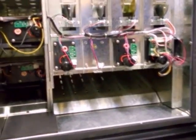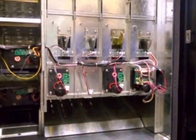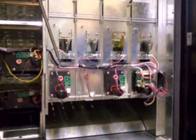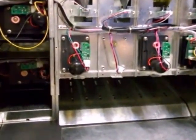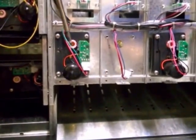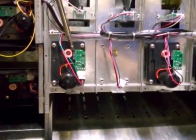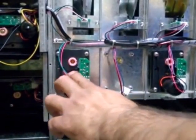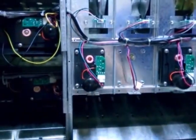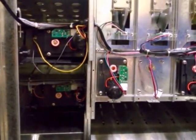You can put a new one back on it again. We have 2 different types of motors. The first type of motor is one that's going to do a half a revolution, so a 180-degree turn. We can see how that is done right here on B3. If you watch the pink knob here, you're going to see it's going to stop once this is over here. We have a sensor right here, a kill switch, that once the button is unpressed, it interrupts the cycle. I'll show you how that happens. Perfect, for 180 degrees.